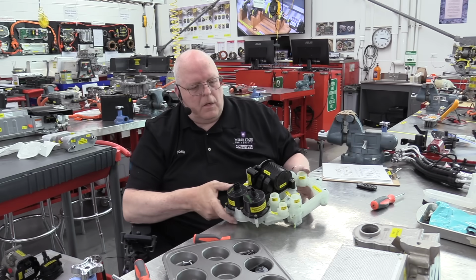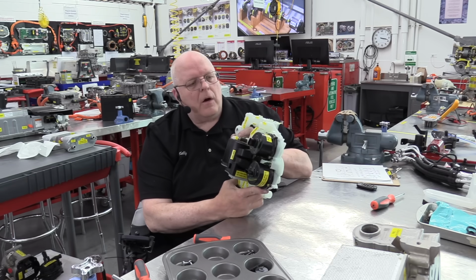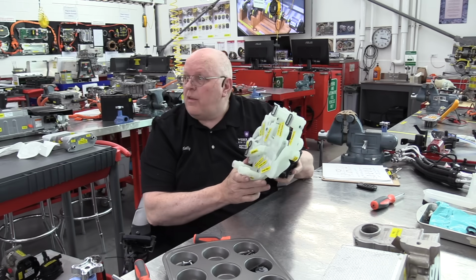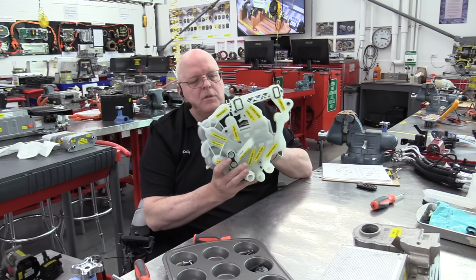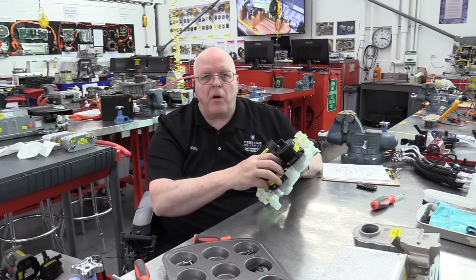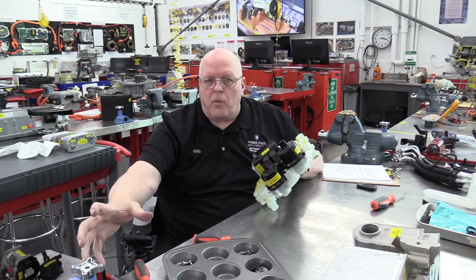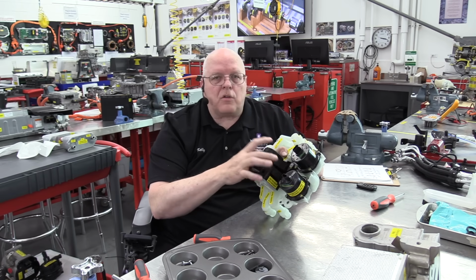Okay. So now we have assembled the back half of the plastic portion of the supermanifold that controls the flow of coolant in the system. And what's beautiful about this design is that instead of having a pump that's remotely mounted with hoses that would connect to it and then hook to something else, they got rid of the hoses and just moved the pump into here. The same thing with the octovalve here.